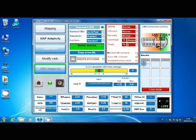Basically, this feature sends just a single DTC errors erase command every time you turn on the key. If it works or not could depend on the OBD system of the vehicle. Anyway, every system allows an error erase if the key is on and the engine is off. So if the customer waits some seconds after turning on the key without turning on the engine, the DTC errors erase will be successful. Even the owner of the vehicle can check it. Okay, so let's have a try.